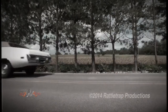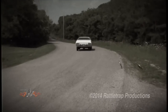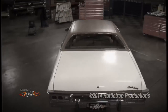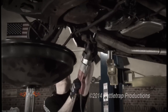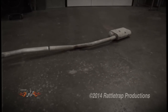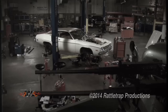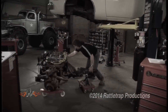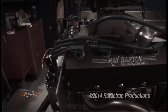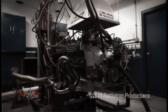As you can see, we started with a 73 Plymouth Satellite that not only looks like a grandma's car, but was actually owned by a 90-year-old grandmother. The first thing we did was drop out the original engine and front suspension, and in its place we bolted up a Magnum Force Transformer front suspension to make room for the massive Ray Barton Hemi we're going to shoehorn into this engine compartment.